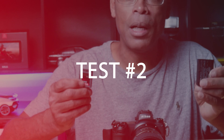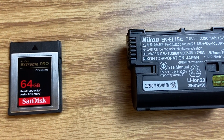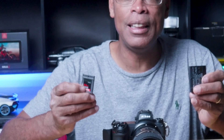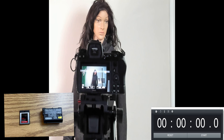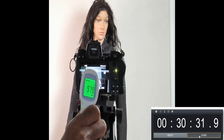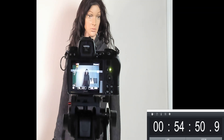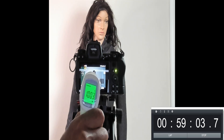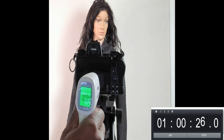In test number two, the primary card for the video is the SanDisk Extreme Pro 64GB CFexpress Type 2 with a genuine Nikon battery, the EN-EL15C — the newer battery with higher capacity. The starting temperature was 81.4 degrees due to the room temperature rising from the previous test. At 30 minutes, the temperature reached 97.4 degrees. At the 54-minute mark, the hot card warning showed, and the temperature was 100.1 degrees at the LCD screen and 109.1 under the LCD screen. With this setup, you get about 10 extra minutes of record time when accounting for the room temperature difference.